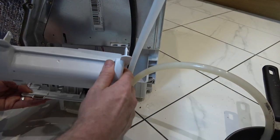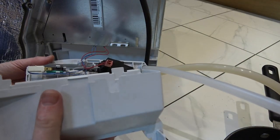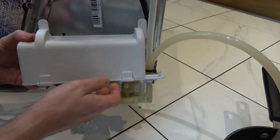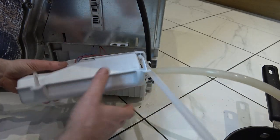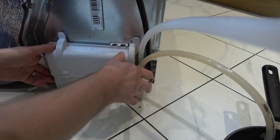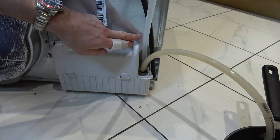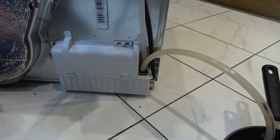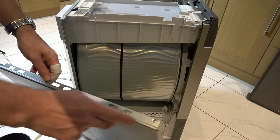I'm going to put this all back together now. The wires go through these little bits here, which then go through this bit here. That all clips in — and I can see now there's also a clip around the back here as well. That's gone in there — clips in. If the post were intact, it would have clipped in there too. Make sure you put the side panel on the right way around with the little hole at the front of the machine — no hole on this side.